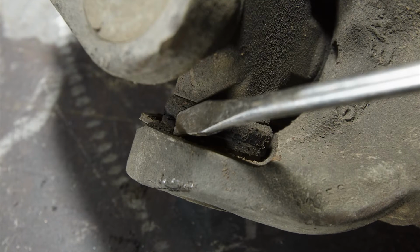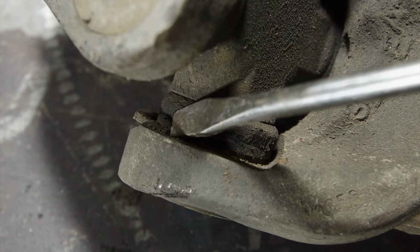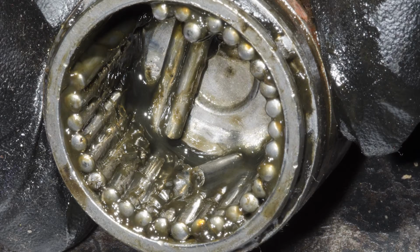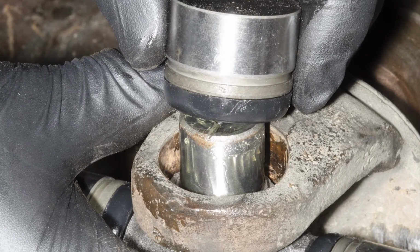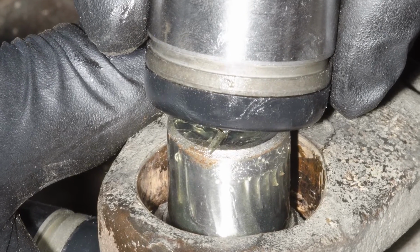With the axles out, disassemble the U-joints. Using a standard screwdriver, you can remove the retaining clips which hold the cap and seal in place. While there's potential for existing U-joints to be in fine condition to reuse, if they are stock or haven't been replaced recently, you may want to have new U-joints on hand. In our case, one of the needle bearings inside the cap was broken. Time for replacement. Holding the U-joint as far up as you can when installing the cap can help make sure it goes on correctly with the needle bearings kept in place.